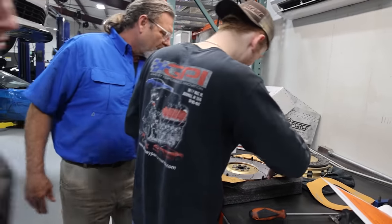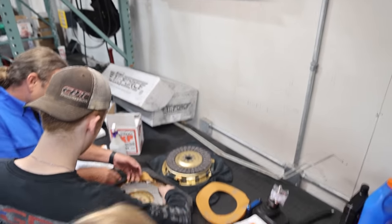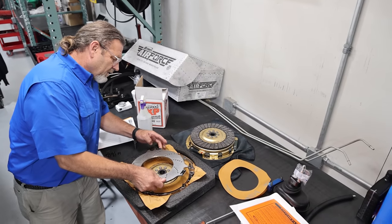What's that? A floater doesn't bolt in? No. That's weird. Yeah, it just sits there. It sits there, but you notice it sits there on these adjustable stops. Yeah, I'm gonna mark where that was setting before. You need to put it in the same spot you got it.